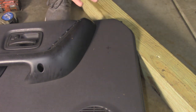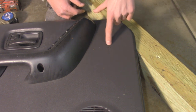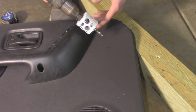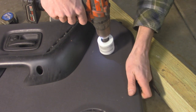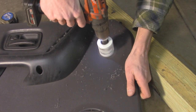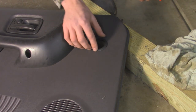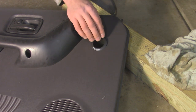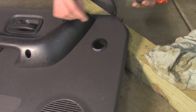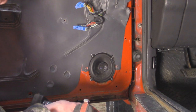I've got the door panel laid out on the ground and I basically just copied the measurements I used on my other Jeep. The measurements are six and a quarter inches down from the top lip, and then three and a half inches coming over horizontally. I'm just going to take my 2 inch hole saw and cut this hole out. With the hole drilled we can test fit it — we've got the outer ring in there. It does have a little bit of play since a one and seven-eighths hole saw would fit slightly better, but this works just fine. It's not going to pop through or anything. The next step is to wire the tweeter into the Jeep so it's all ready to go when we put the door panel back on.